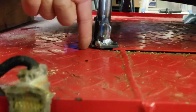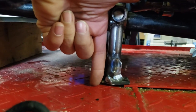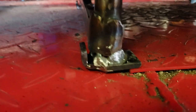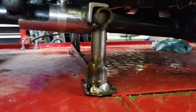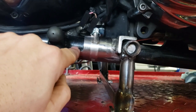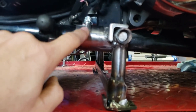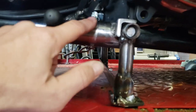It's still only a total of about three and a half inches off the ground at the center stand, and obviously back here at the bottom of the swing arm it's even lower. The welds are ugly — I know I'm just learning how to weld — so I'm going to clean that up a little bit, and ultimately it's going to be powder coated. I'm still determining whether I'm going to weld this to the bike or not. I'll probably keep it just clamped on and get rid of these band clamps and get exhaust clamps to put on here.